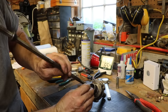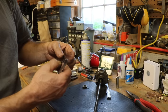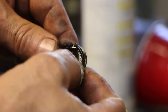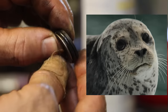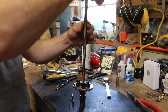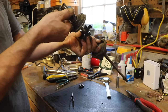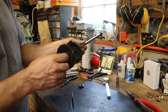Here's the water pump housing on the drive shaft, splined up here. These two things fell off when I was taking that out, so I'm going to have to figure out how those go back on. I noticed that sitting on top loose is an O-ring that does not appear to be in very good shape — that thing is hard. Here's our beat-up cracked O-ring. This piece has a step on it that the O-ring fits on quite well, and then squish a washer on the other side and you essentially have a seal.